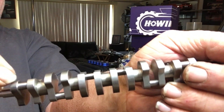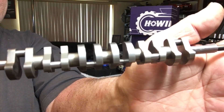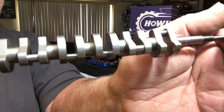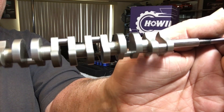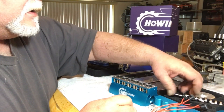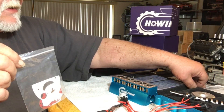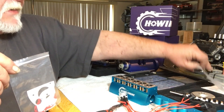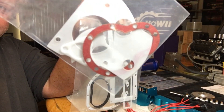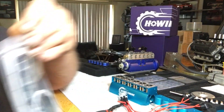The quality of this crankshaft is really good. I checked each journal on here — your rod journals — and they all come up to be 5.99mm, because it's supposed to be a six millimeter journal. So that 5.99 gives it just a little bit of room to keep oil inside it without running dry. Other than that, it came with a full complete gasket kit: head gaskets, belts, oil pan — and these are the Teflon-style gaskets. The timing cover in the front has a paper one, but the Teflon ones are really cool because you can reuse them over and over again.